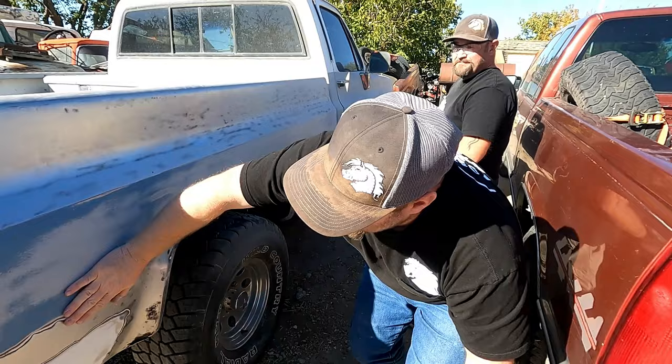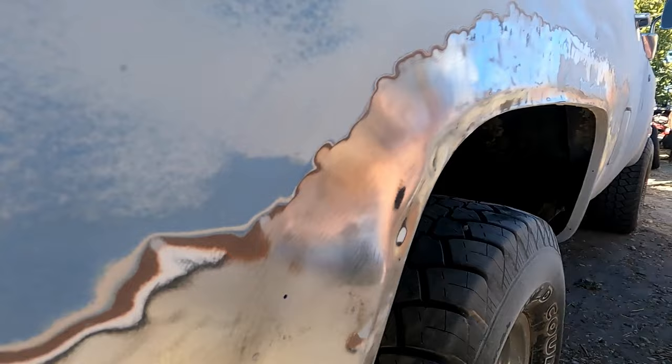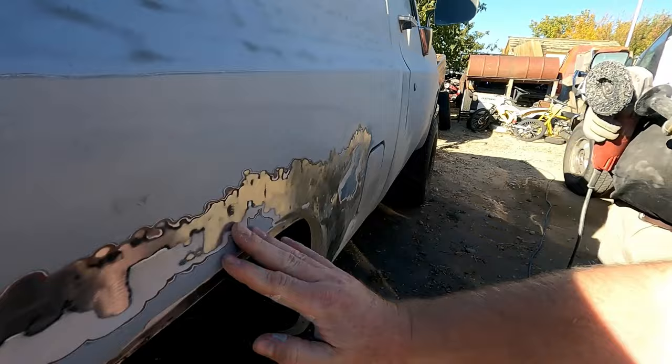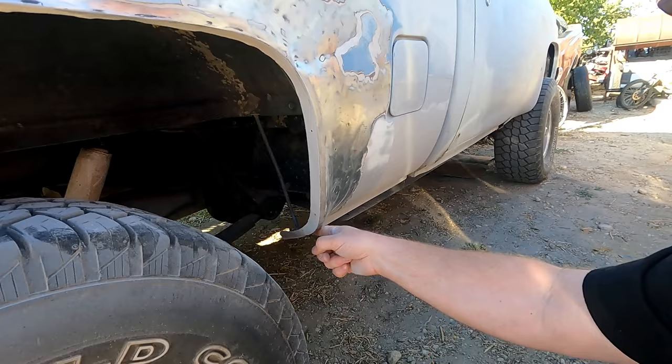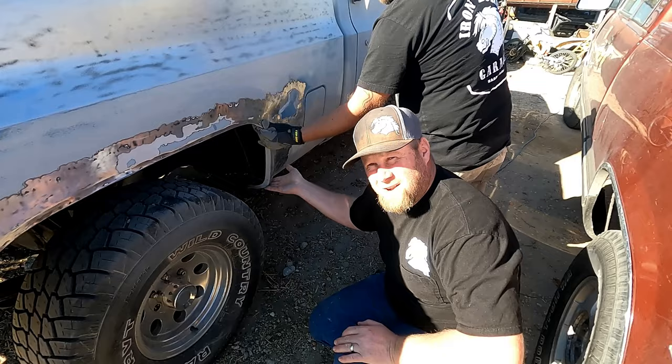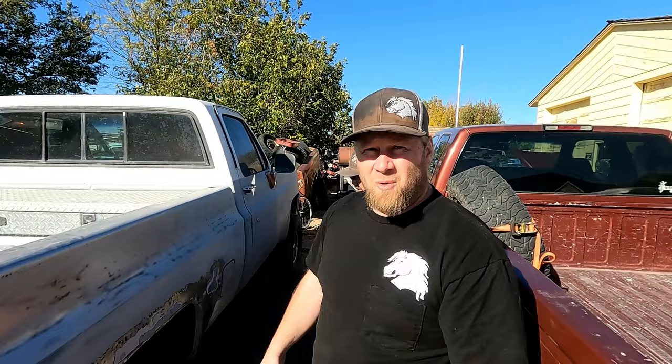We've got this thing sanded off, stripping her down, and what we're finding is not good. Somebody put at least a quarter inch thick worth of Bondo in here — there isn't even a body line there anymore. We've got deep Bondo here, here, and here. All somebody would have had to do is take a hammer and dolly to that dent and smooth it out, but instead they filled it full of Bondo. There's actually nothing wrong with the panel other than it needs flattened out. That's the problem with people doing body work who maybe don't know or research enough — they just fill it full of mud.